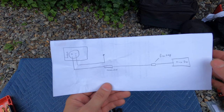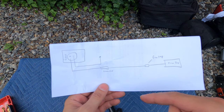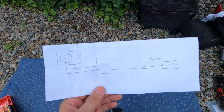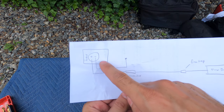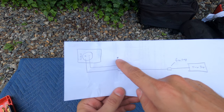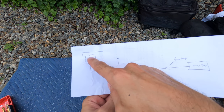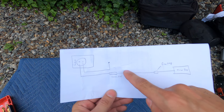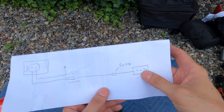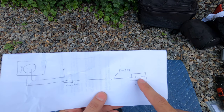Now let's wire it up. Whenever you're doing any wiring on your car, it really helps to just make a diagram so you know exactly where all the connections are going and what wires you're using — it just simplifies the whole process. We start with our socket back here — we have a positive and a negative. We're going to take the negative and ground that to a piece of metal on the chassis. The positive from the socket is going to go all the way to the fuse box. We're going to need a connector because the wire just isn't long enough, and it's going to connect to our fuse tap.